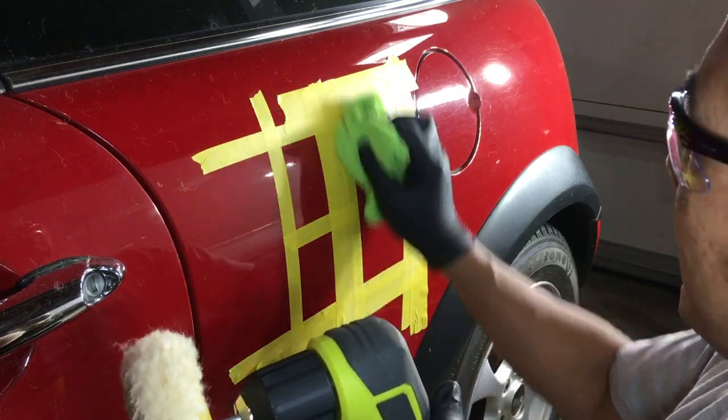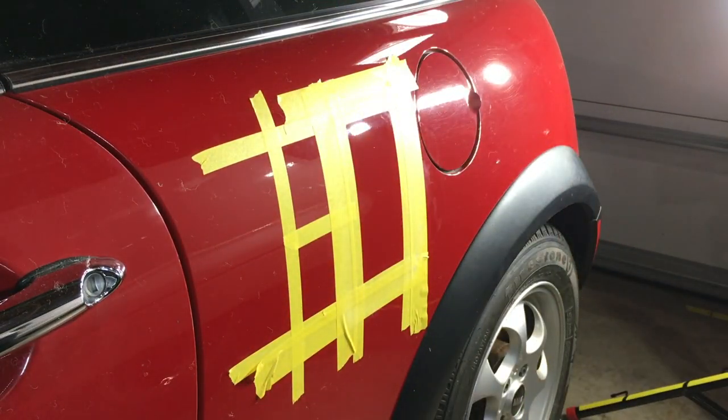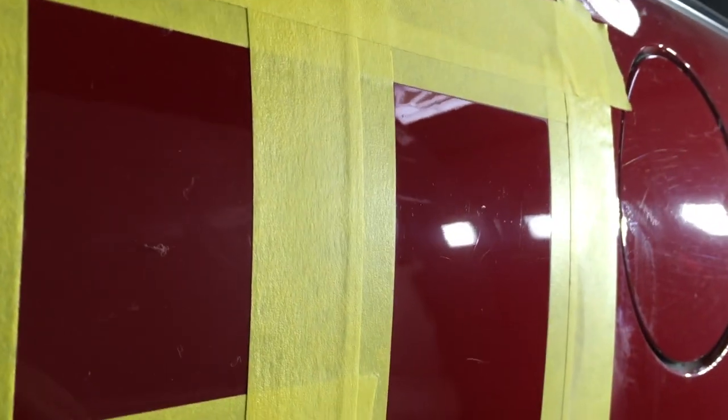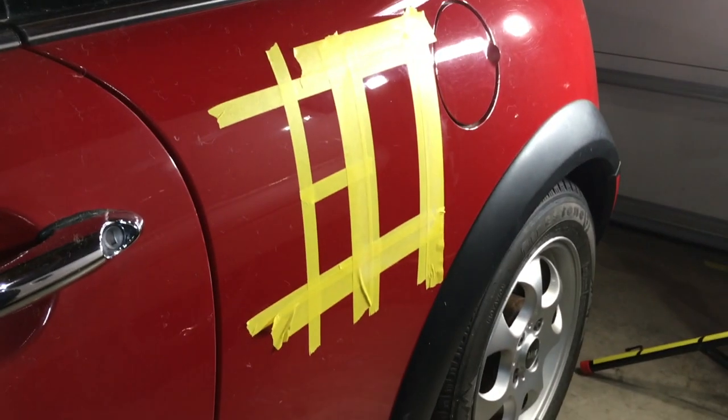So the thing is, this thing is at 1100 RPM. And you can see that 1100 RPM brings it back. We don't have to go and crank it up any further. It's already smoothed out. So you can look at the lights. It's a little bit clearer. The actual light itself, the tiny little LEDs, you can see them. They're a little more distinct, refined. This is all hazy and scratchy. This is better, and this was untouched, so you can see the difference. There. All right, so we can go further now. That's just wool pad. That's a quick pass with 110 on a wool pad.